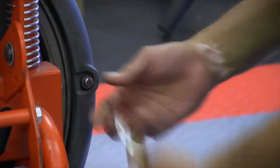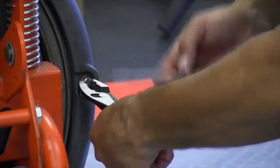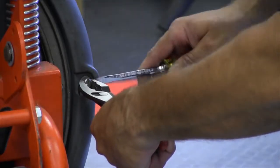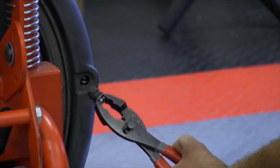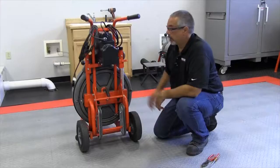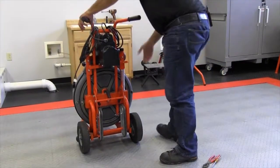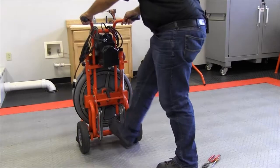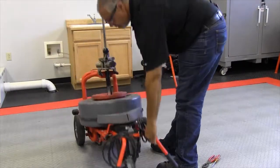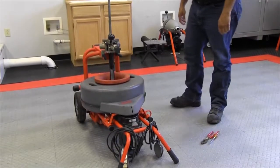What we're going to do is back out this screw. I'll grab it with a pair of pliers on the head and put a screwdriver behind it and pull out your drain plug. At this point, what you want to do is tilt this towards the bottom, lay the machine on its back, and let the machine drain.